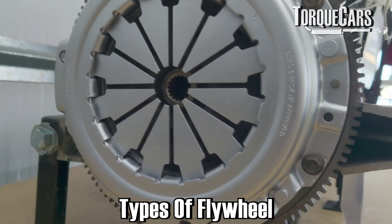There are two types of flywheel: there is a solid flywheel and a dual mass flywheel. We're going to explain the differences between those, and most of these problems are actually related to the dual mass flywheels — they're a little more complex in their operation.